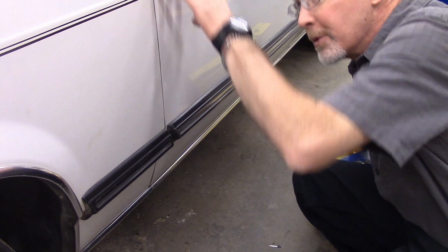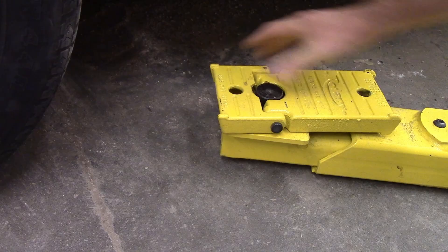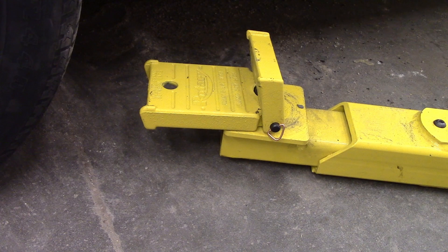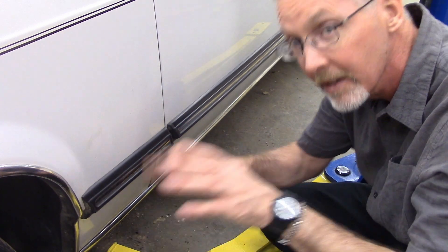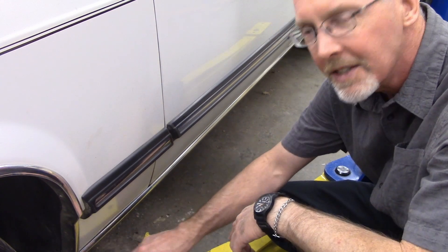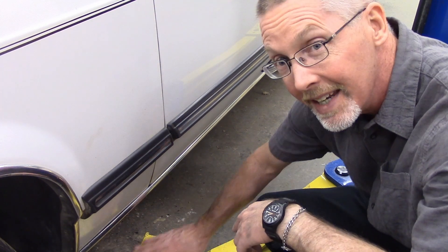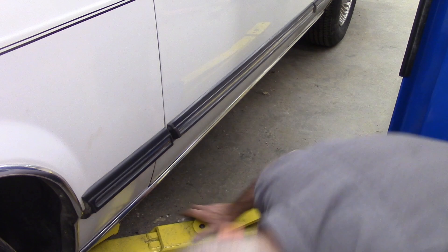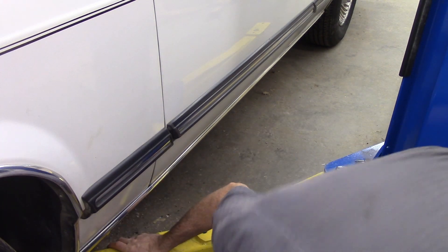So this is an asymmetrical lift, and we're going to set up the arms. The front arm is really short and swings out like this — there's usually a way to extend it to fit different things. This particular hoist has a short stubby lifter and a bigger one for if you need more lift, depending on the height of the vehicle or if there's a chassis rake. This car has a full perimeter frame, so right under here is a big chunk of steel that is framed. I'm going to position this where I think it needs to go, crawl down and take a look, and then do the back one.